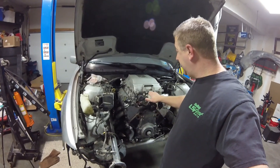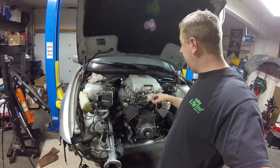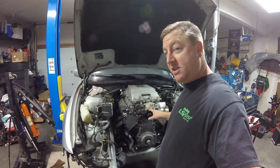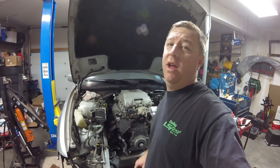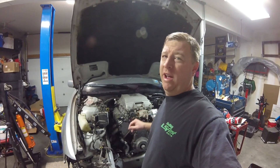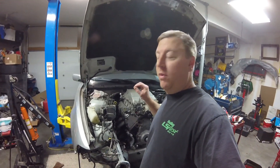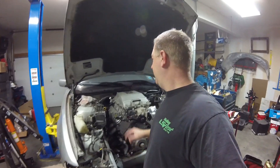What I need to do is take this snout off the front - it just bolts on with a few bolts - then change out my isolator, get my pulley hub pressed on, and port this snout. You can gain anywhere from 20 to 40 horsepower just by porting that snout out. You'll see how restrictive it is when I get in there. I can also port the supercharger where the inlet meets the rotors, so I think I'm going to do that too and freshen this thing up. Let's get to work.